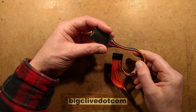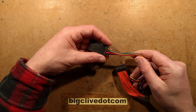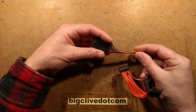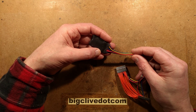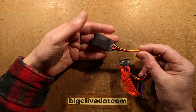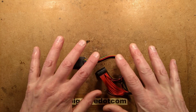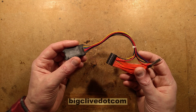It was sent in by a mechanic called Dave, who said he removed the device from a 2015 Mercedes E-Class which had come to him for multiple warning lights on the dash. His diagnosis found this small circuit connected between the instrument cluster and a wiring harness, disrupting the CAN lines and shaving 40,000 kilometres — about 25,000 miles — off the displayed mileage. That would affect the value of the vehicle greatly, allowing it to be sold for a much higher price.